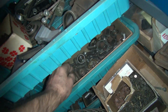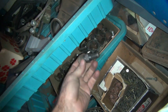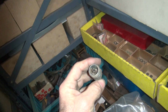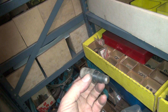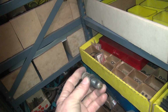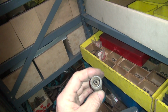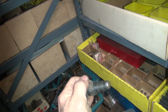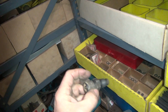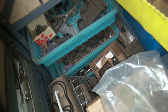See, your junk box of parts back in the 80s become valuable parts in the 90s, and in the 2000s even more valuable. See, that's how you plug up your speedometer drive on your old 60s and 50s Sportster case. You take the drive unit, you cut it off because you don't care about it, and you weld it up solid. Now, if I cared about it, I would have taken the drive out of it and kept the darn thing. And nowadays they make a plug that goes in there. And I even got the genuine Harley plugs, but back in the day I didn't have them. I just cut up pieces and used them because they were worthless. It was one of the parts you couldn't get $1 for back in the day.